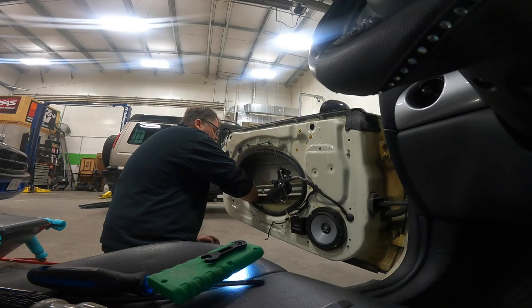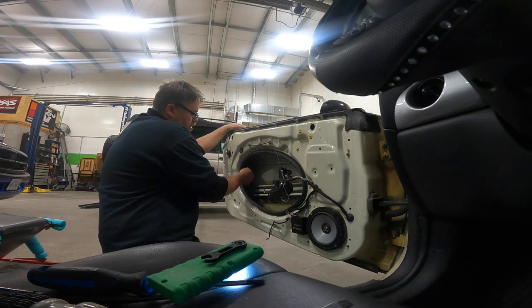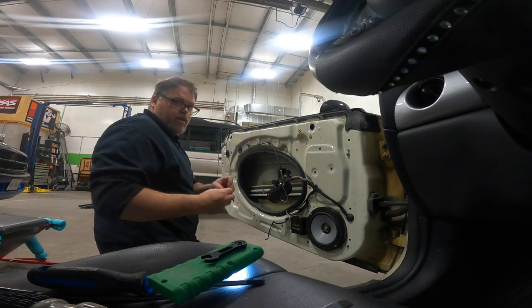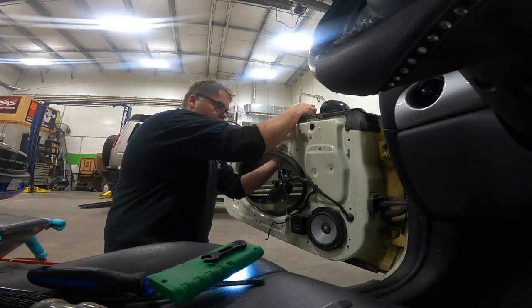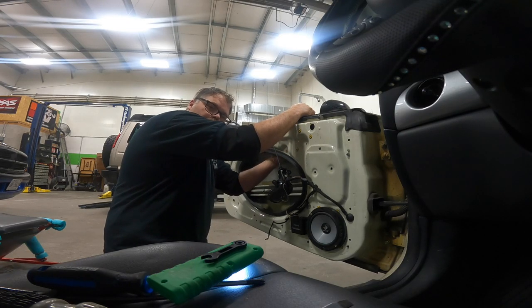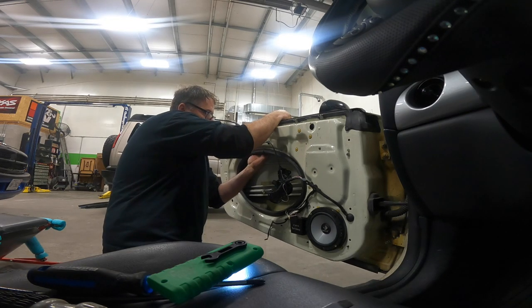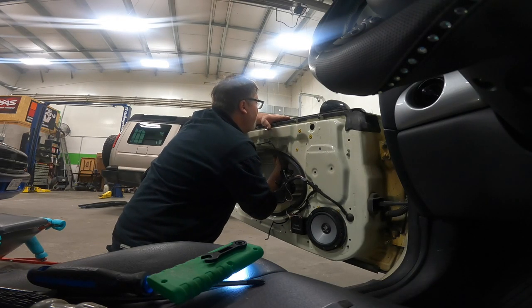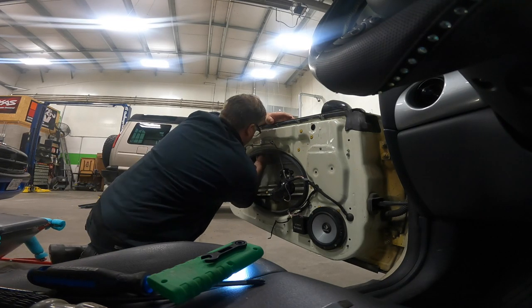This actually bent the bar yesterday — that's probably what broke the regulator. So it comes with a little clip here that goes up in there, and then it comes with two of these that go up in here. My suggestion is to unhook them and leave them in there because they're a real pain to get in there, and then just put the new cables into them. Make sure both wires are in because if they're not they'll get caught. The bottom one goes into the snap like that, and then the other one goes into the snap like that. Make sure these are done up — do not leave them undone or it's going to catch on something.